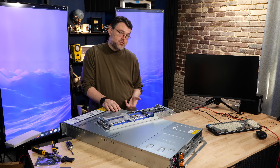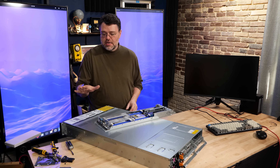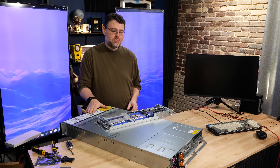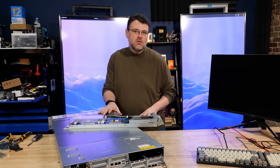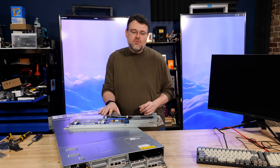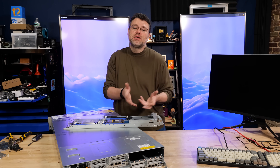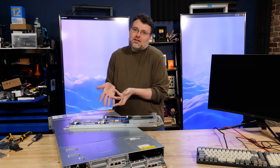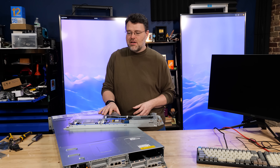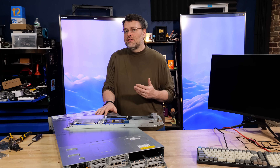If you lose an entire chassis, you can reassign those PCIe Express peripherals to another node immediately without moving any cables or cards - that's what composable infrastructure is. But if you can afford composable infrastructure, you're probably going for the Genoa SP5 DDR5 platform. These are good research and compute nodes where you're going to need 20, 50, or 100 terabytes of local storage to cache your data, plus a high-speed network connection to the rest of the cluster. Gigabyte has a lot of customers in that enterprise space - more than retail end-users. Entry-level for that level of customization is probably around a million dollars.